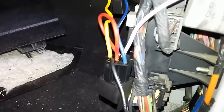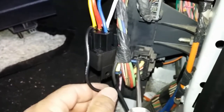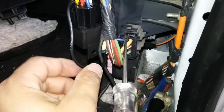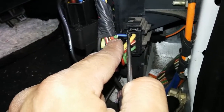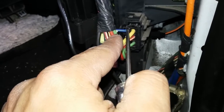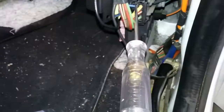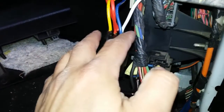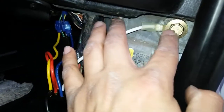This is a 5-pin socket and a 5-pin relay. The wires that I used were yellow, black, white, and blue. The black one is our control feed, which is our power feed — tied in with that blue with green stripe wire. That wire only provides power in position number two, but not position number one, and only with the vehicle running. As you can see, the test light is connected to ground and that wire is not currently providing power, so the test light is off. That's going to be our pin 86. Our pin 85, which is our common ground, is bolted to chassis ground.